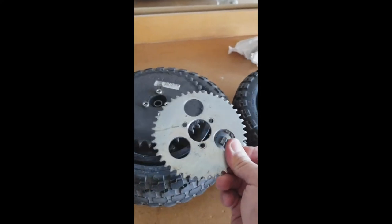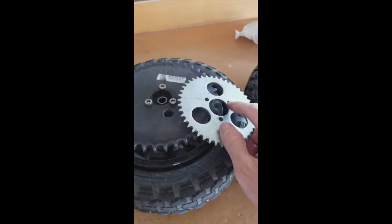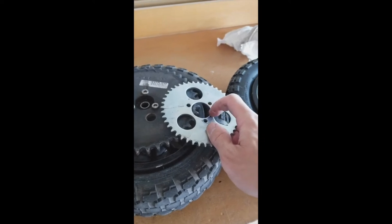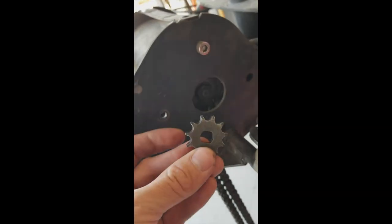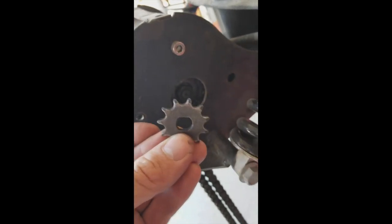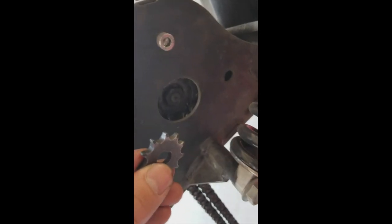What I did was I brought a sample rear sprocket to a machinist and had him drill out the slots to match the inner hole and the three mounting holes. This here is the front sprocket, and I really don't want to take it out because it's a lot of hassle. Essentially, you order this part from Amazon, then take a stock front sprocket and show it to your machinist and tell him you want him to machine out the middle just like this.